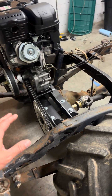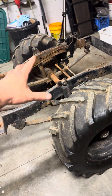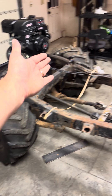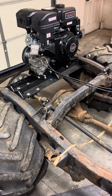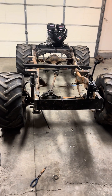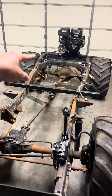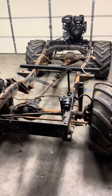With that, the four-wheel drive system is hooked up. It's got lock-in front hubs so you can open those up if you need just two-wheel drive - or technically one-wheel drive, since it's open front and rear. I did not want to weld either differential up because I want it to still be safe whenever anybody else is driving this thing. It's just a crate crawler, literally just meant to creep around. The max speed is anywhere between eight and ten miles an hour with that 55-tooth gear sprocket - if I went with a smaller one it would go faster but have less torque, and right now torque is what I'm looking for.